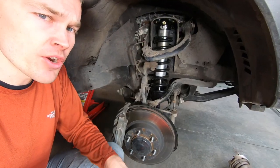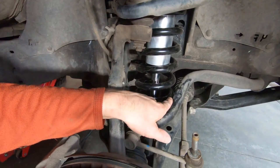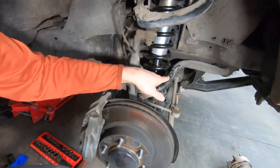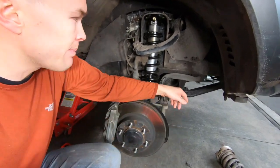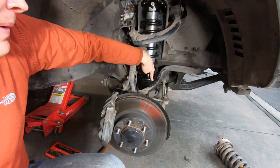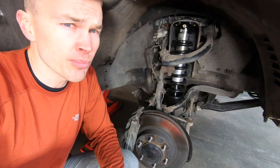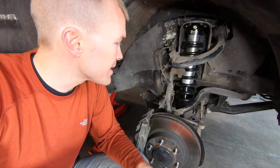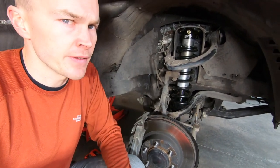With that, the installation of the new shock and coilover is basically complete. However, looking closely you'll see there's rubbing between the coilover and the sway bar on both sides of the vehicle. The Stage 2 kit comes with a relocation kit for the sway bar — it puts a little spacer in that drops the whole sway bar down and gives better clearance, preventing rubbing that could create serious issues while driving. So the next step is dropping down that sway bar to get the clearance we need on both sides.